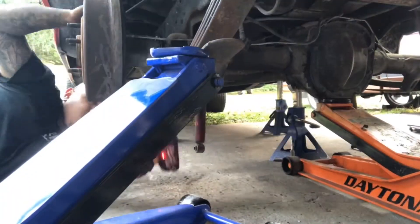We've got the C-notches pretty much in place. All we've got left is to weld them up, cut that excess out, and then plate it up and weld it. Then spray it black. But we're getting it done. Guy's got the Reckless Kit underbend notch - we'll start welding some.